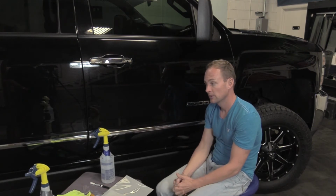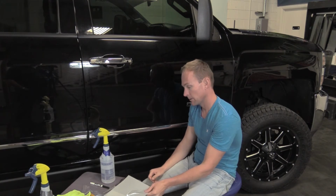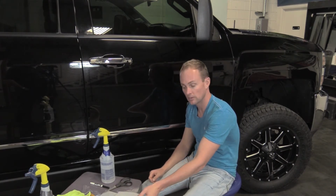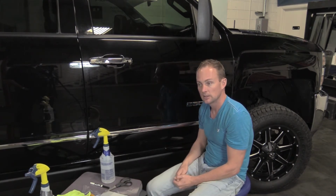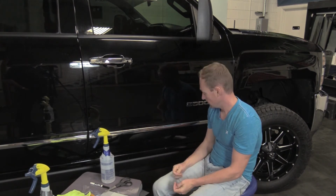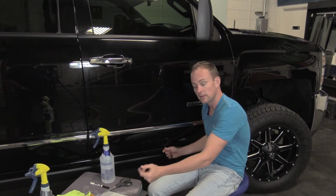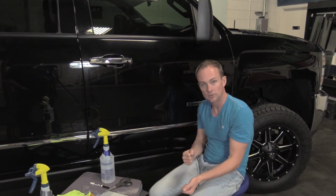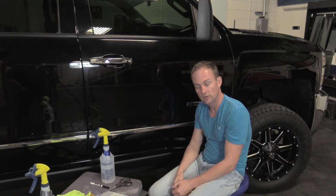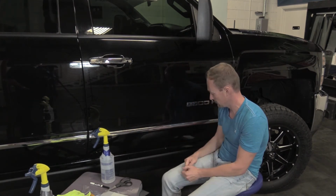I know that sounds probably like something that most people wouldn't want to do. If they've got a kit, they want to get it put on. They don't want to wait 2 days or a day for this stuff to dry. But what you'd rather not do is buy the pen, buy the kit, touch up the paint, and then rip the chip out of there, positioning your material, and then you've ruined your kit and your chip's not fixed anyway. So do the job right the first time.